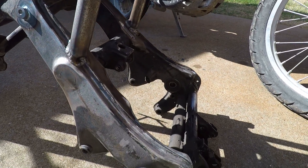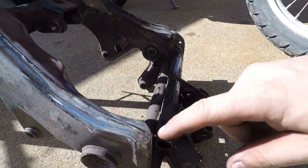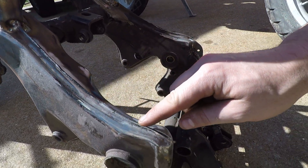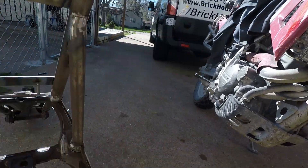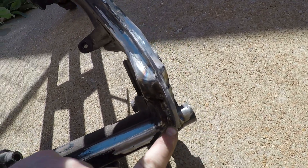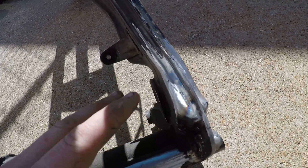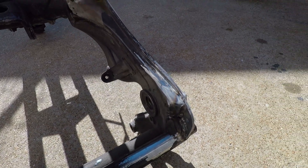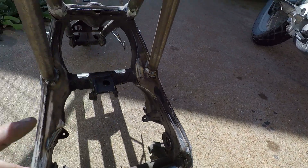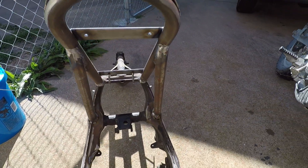Let me show you the frame here — completed the end. There's a basic cap on this side, and then I took some steel to simulate this ridge going back down. Had a little fun on this side too — the exhaust hanger — I just followed that line. All of this is new, capped, and blended so it all visually makes sense. Everything else is welded, including the ignition switch mount up there. It's all done.